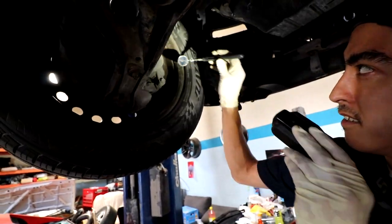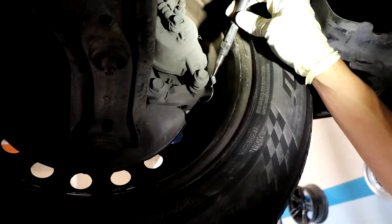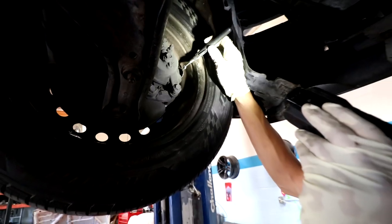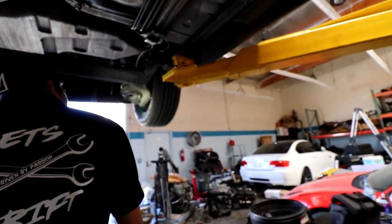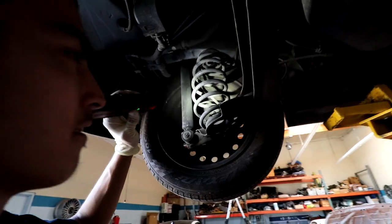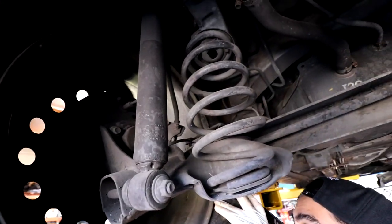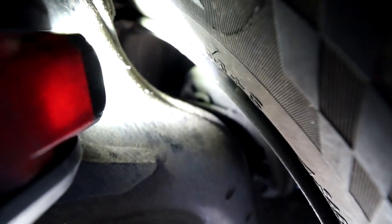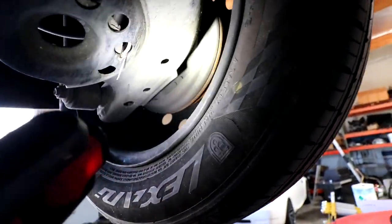Keep in mind: just because you can see the inner pad and it may be in good health at eight millimeters, try and check the outer pad too — especially on both sides — because a lot of the time one pad might wear down faster than the other. I've had cars come back because I said the brakes were good but one pad was very low, and it bit me because I didn't do a thorough inspection. Coming to the back, these are drum brakes so you won't need a mirror. On this vehicle there's only a little peek hole, which is very hard to see, but just find the right angle. You don't see drum brakes that often anymore, but when you do, if you can't see them, just take off the rear wheel and pop off the drum to get a good look.